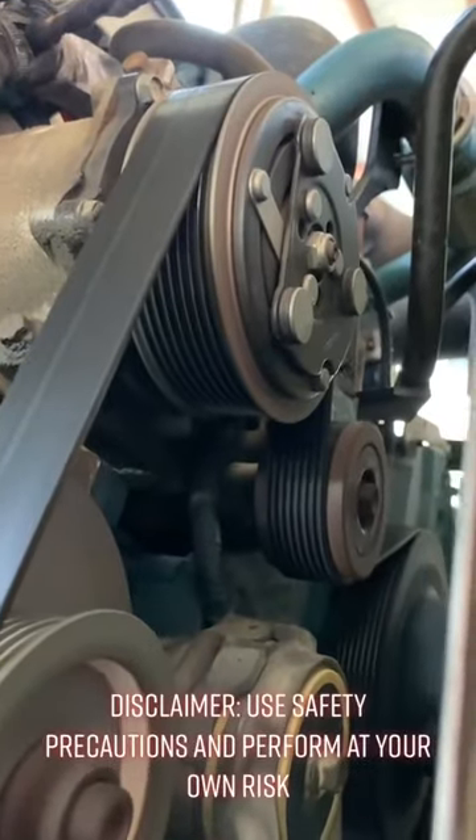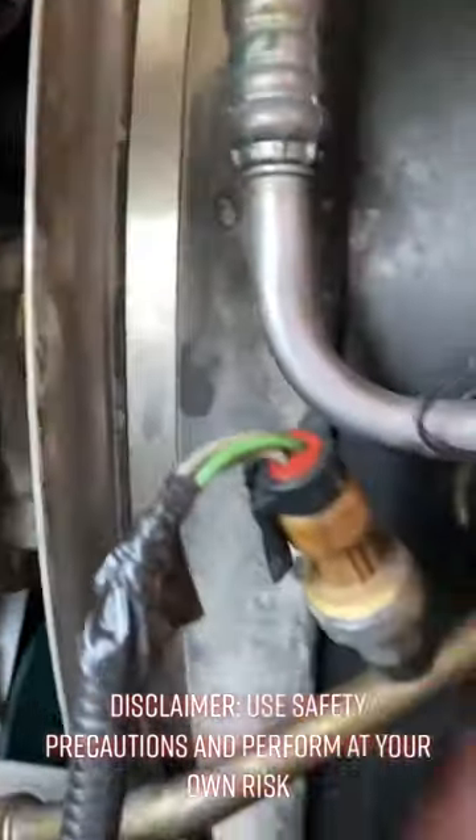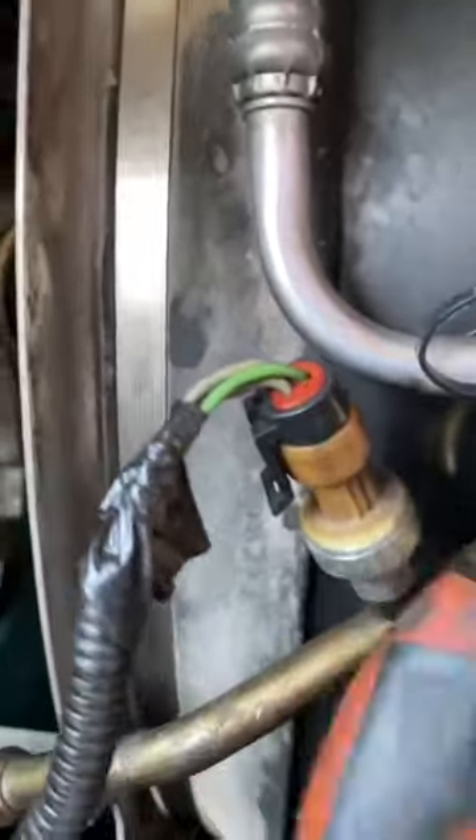On this International truck, check to see if it's sticky. One way you can verify if it's sticking is by simply tapping it like this. If your AC compressor clutch comes on after that, well then you know your sensor was just faulty.